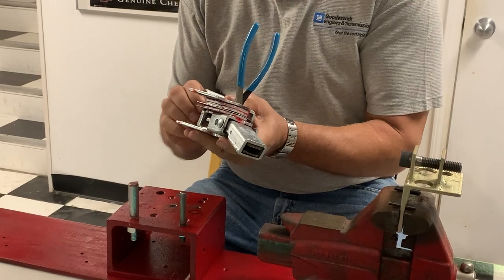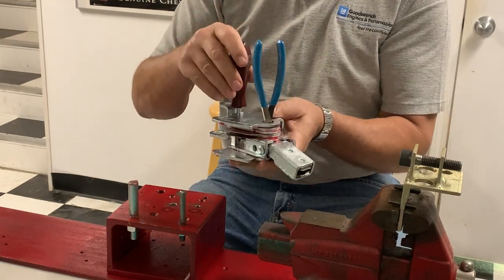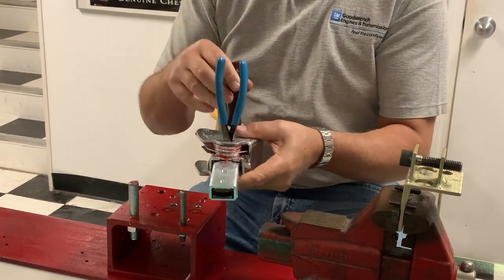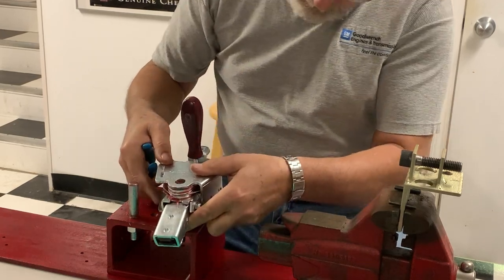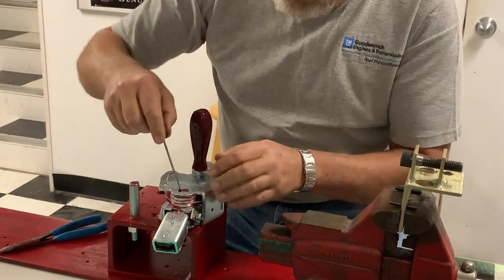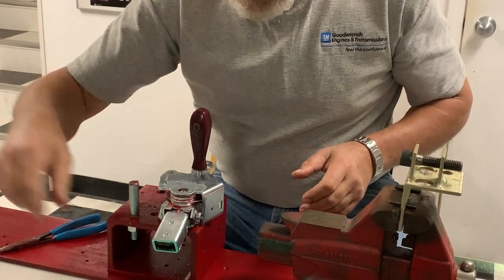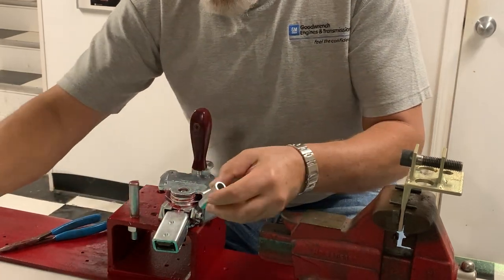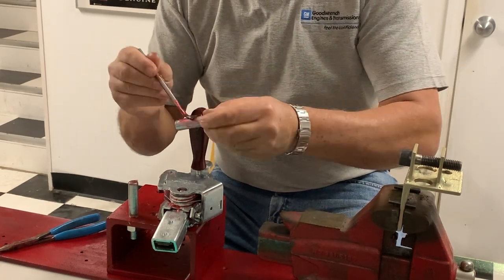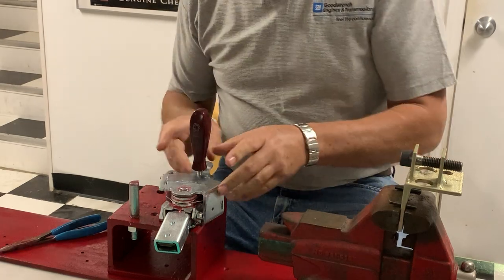If you get a number two Phillips screwdriver with a quarter-inch shank — just like the quarter-inch lineup tool for the neutral gate when you're setting the shifter up — now you pull that out. You've got the other bung here; it slides in. Everything is in place. Just use a little screwdriver to center all the plates together, then lube everything up, and now we're in place.